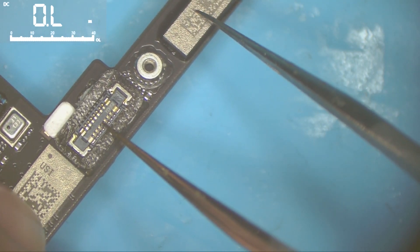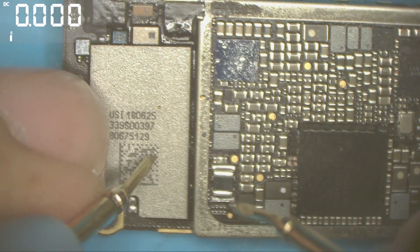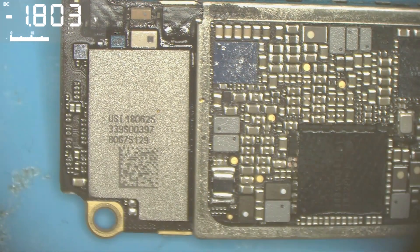The phone switched off. Now it's back on. Under here there is one capacitor, and you can see 1.8V. Also, if you go to the menu and check About, you'll see that Bluetooth is working but only Wi-Fi is not working. This means there is a power supply reaching the chip itself.